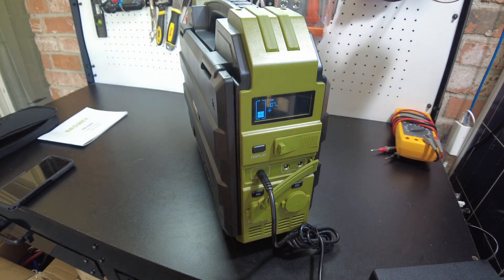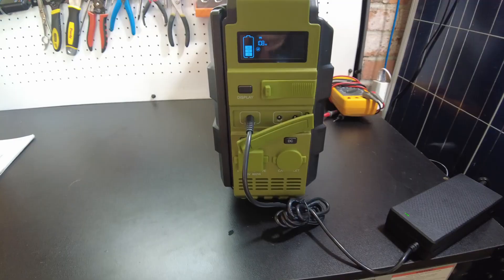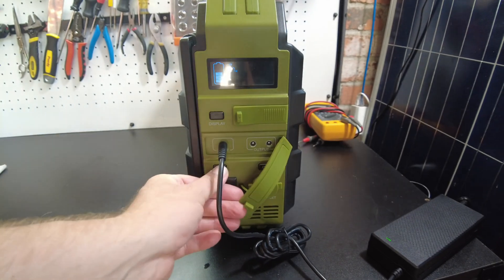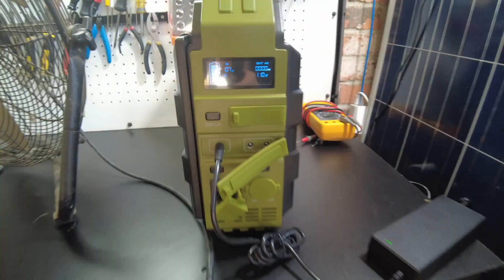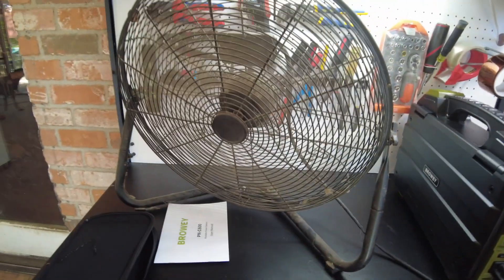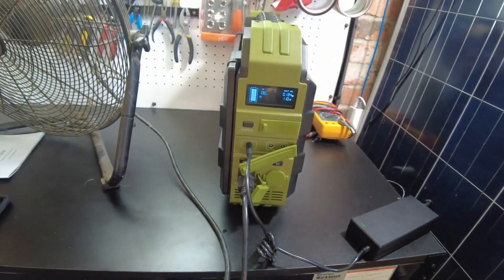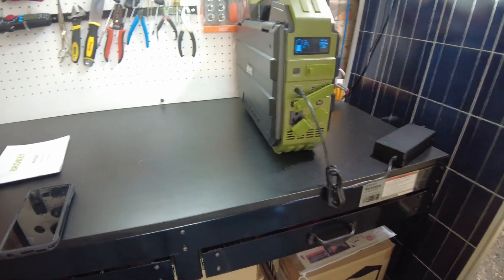Maxing out at 107 to 108 watts with a 600 watt-hour battery, it's going to take about six hours to fully charge. Now everybody always asks: can you use the AC output while you're charging? Let's turn the AC output on — it's definitely on and we are still charging. Let me hook up this fan — yeah, it's coming on and we are still charging. So yes, you can charge this unit and use the power at the same time.